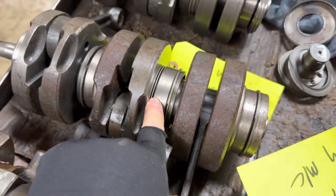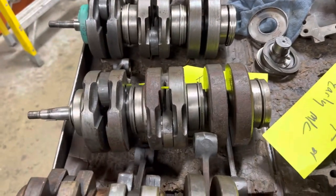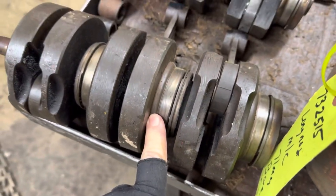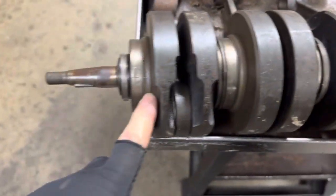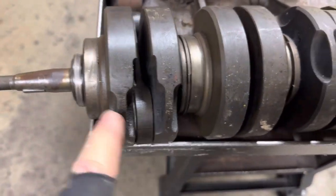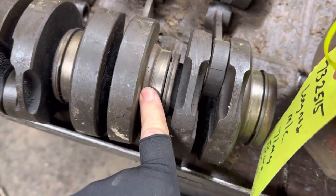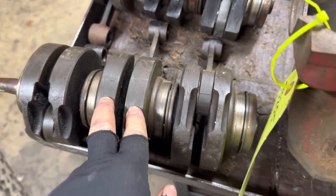The GT does not have one on the backside of number two, but when we move into our lubrication deluxe crank, then we have one on the backside also. That's the same as what we have on a Monte Carlo, which is a 515 block. So you've got a three oil slinger crank — one, two, three — and then you've got the one with four. The lubrication deluxe and the Monte Carlo all have four of these oil slingers.